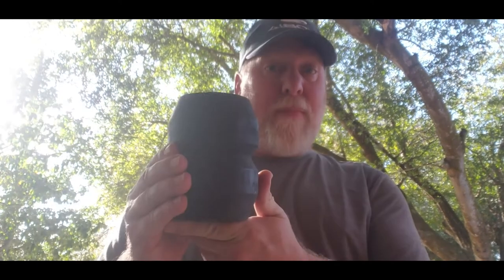These are like a bigger bump stop than what's already underneath the truck, and I hope that it gives more support so we can tow the boat a lot better. The way we're towing it now, I don't feel comfortable taking it two hours away from where we are — either side of the coast, whether going to the Gulf or the Atlantic, everything is two hours away. It's only around 1500 pounds, it should be able to tow that boat with ease, but there is sag in the back of the truck. Hopefully these Timbrens — this is the DR 2500 — two of them should give a little more oomph to that suspension, beef it up a bit so we can tow with ease.